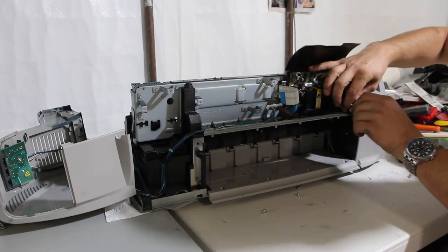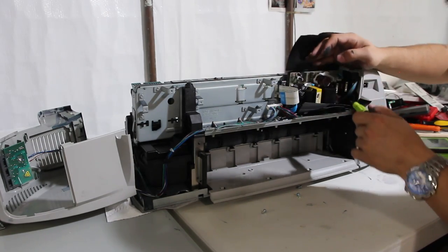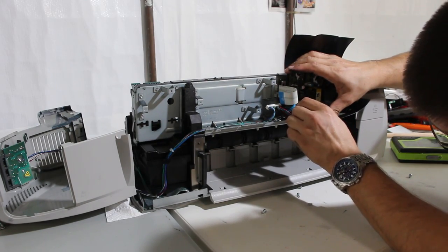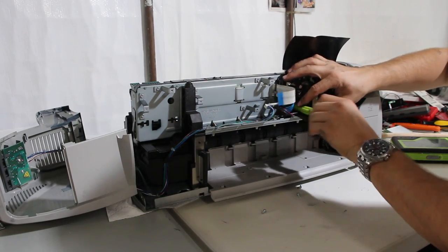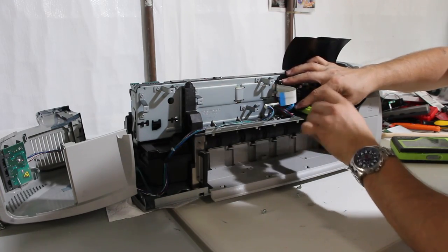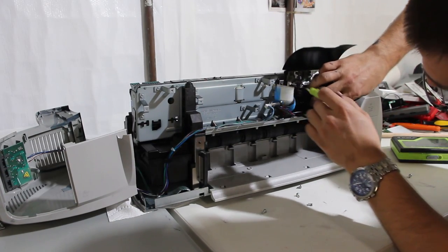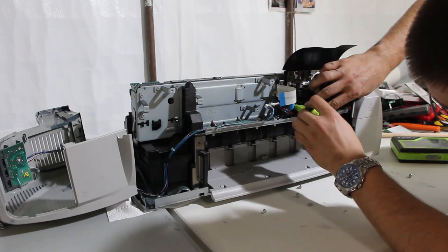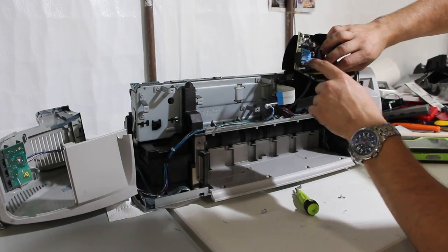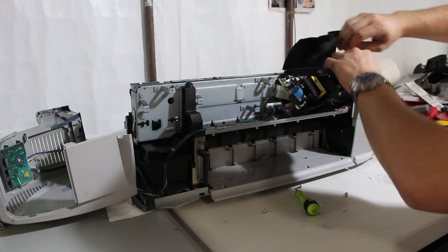Even though this printer has been turned off, chances are the capacitors could still, right now, contain a charge. I haven't confirmed and shut them off yet. I've just worked long enough on these, I know what to touch and what not to touch, I suppose. So, be careful. Alright, let's see. I think that should be about it. Alright. And you notice the blue wires here are considerably thicker than these data lines, and that should make perfect sense since it's carrying higher current.